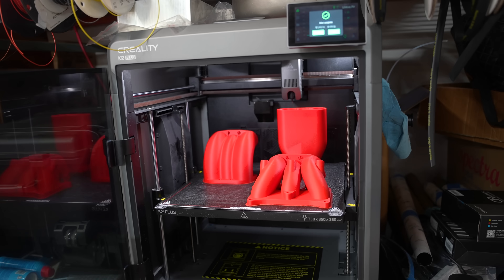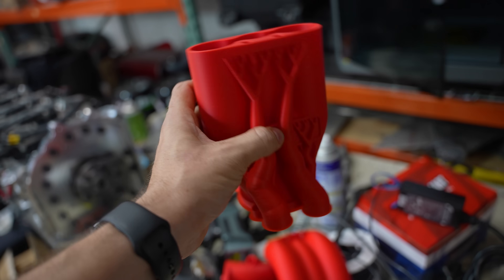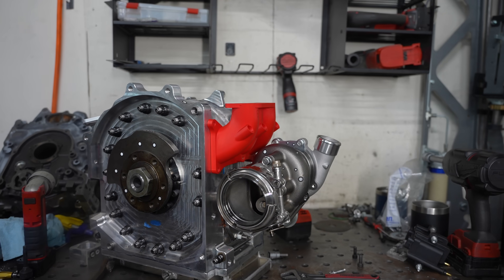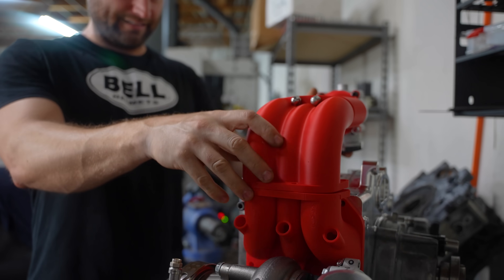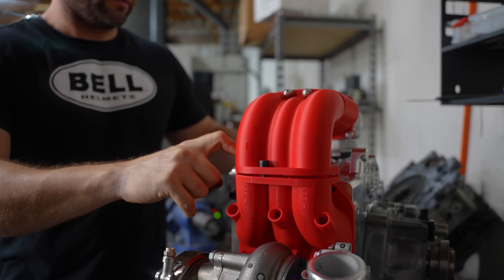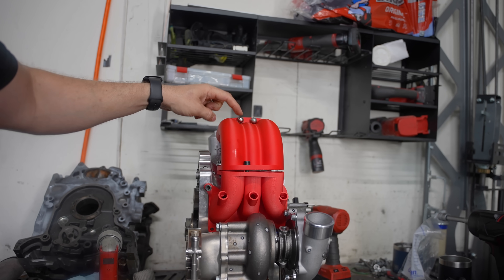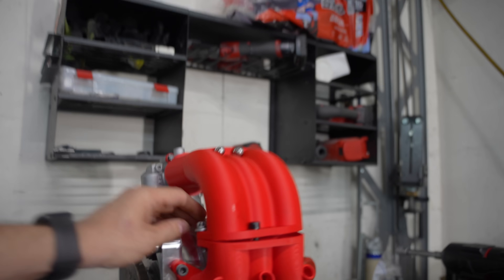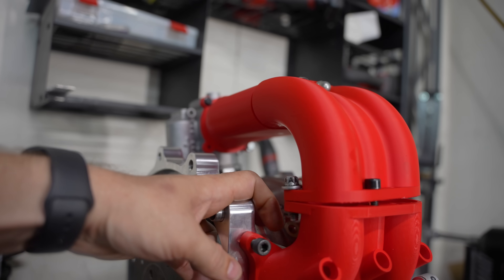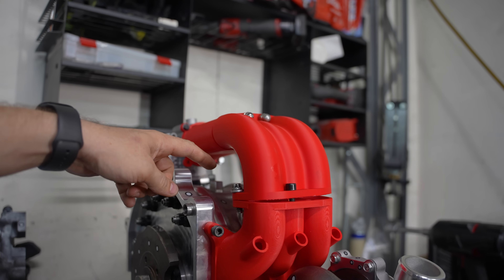This is super exciting — Finn has designed the one-rotor intake manifold. Couldn't wait for Joel, we're cracking this open. We've got some tentacle supports to pull off of this. That's our biggest area of concern — that's the nut side that we might get creative with. We'll probably have to make these bolt holes a little bit bigger. What Finn did is went straight through the center of each of the outer circles — that's going to hold it nice and tight under boost. This area is now really empty because there's no fuel rails and no ignition coils, so anything we can do visually to fill that space with purpose is a win.